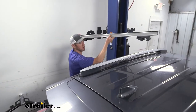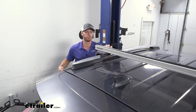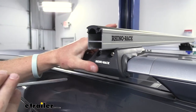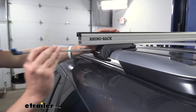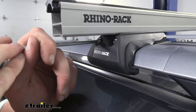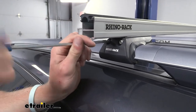So now we're ready to put the bar on our raised rails. See how it just fits in there? I could have probably opened that up a little bit more, but that is what the tool is for. If it's doing this, just take your tool and loosen those two bolts that we loosened up earlier — we're just going to need a little bit more to get it to sit down. Just like that. Be a good time to get the measuring tape out, make sure it's nice and even on both sides. Then we can take that same tool and as we tighten these up, it's going to bring in that other clamp, which is going to secure it down. I like to do it really lightly at first on both sides so it's nice and even, and then you can start really torquing it down to get it secured.